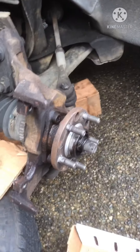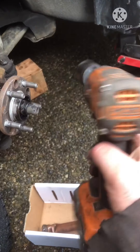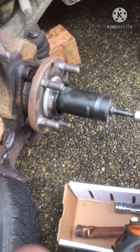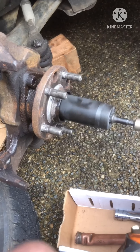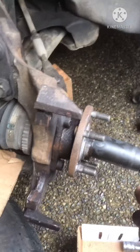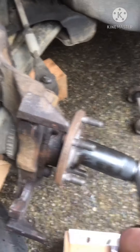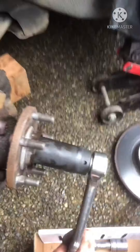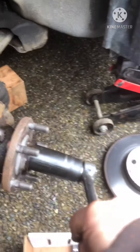The rotor is going to come off, and now that I've pre-loosened the axle nut, I've only got a regular impact wrench from RIDGID. Now that it's loose, the impact is just very weak. The batteries are fine, but if the vehicle were in neutral right now this would spin. We are going to put it in neutral after so we can spin it, but right now you don't want it in neutral.